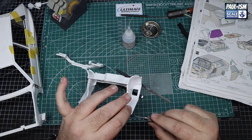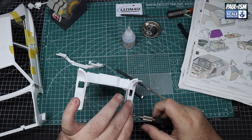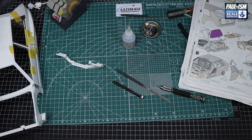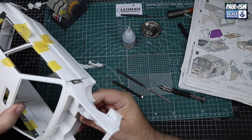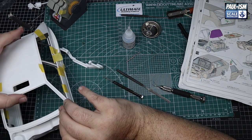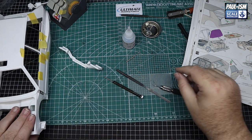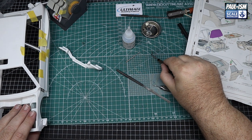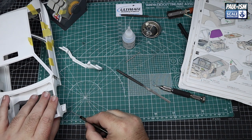And then while we're at it, we're going to take the bumper back off. And we're going to fit the inner engine bay piece in as well. Wasn't originally going to do this. And I thought, you know what? Sod's law, I'll forget to do this and it won't fit. So that literally slots in at the back, slots in at the front. There's two more holes where we mounted the valance in. So they're drilled out as well. The same 1.4 by 3 mil screws hold it all in place.